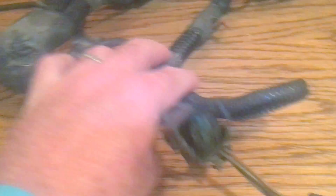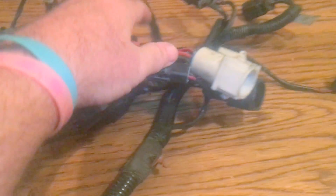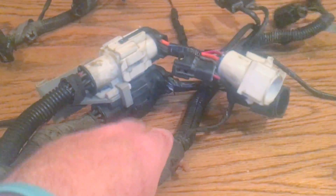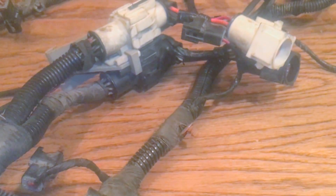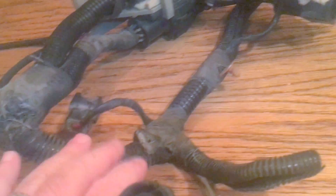How do I find the EGR connection? It's on the back of the harness right here. This would be the back of the engine, this would be your banks, looking from the back, passenger side looking forward. This would be your 1, 2, 3, 4. So it's back here by your fourth cylinder on your passenger side of your harness.